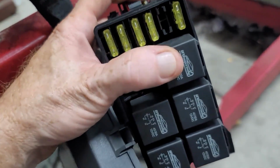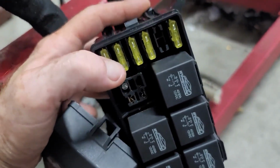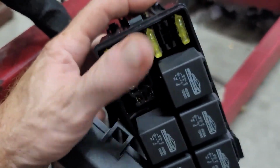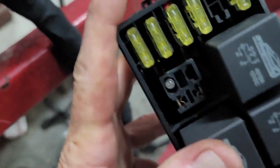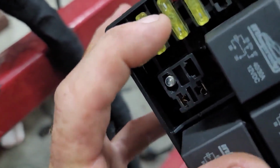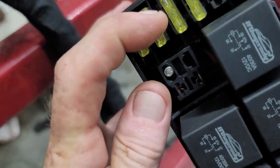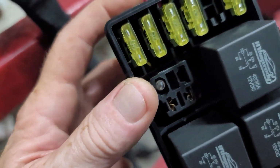Okay, there's your starter motor relay, and then here you've got 6 slots. You've only got 5 because this is a non-VVT, but everything's been individually fused. You'll see over there is a LED, and there's 2 open terminals. Those are for your OBD1. If you put a bridge in those 2, you're going to find that LED will flash codes. So it's OBD1 flash codes.